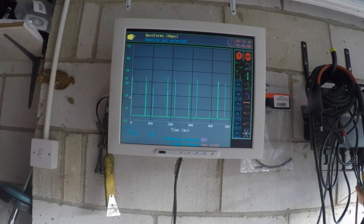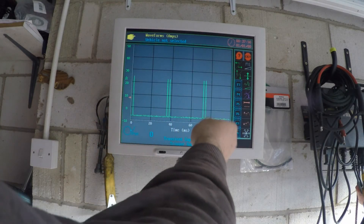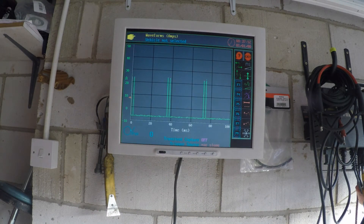The scope is really old - it's 30 years old so it jumps about the place. There's a second time base. If I go back - there you go, that's over 50 milliseconds, two pulses. If I go over 100 milliseconds I've got three pulses, so it's every 30, 60, 90 and it must be 120 for the next pulse. You can see all these pulses are pretty much the same, so that's a good test of the diesel injector. And that's on a two litre diesel engine. Cheers.